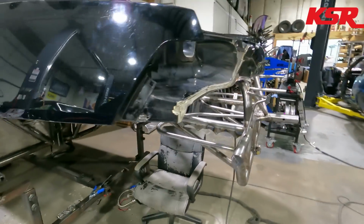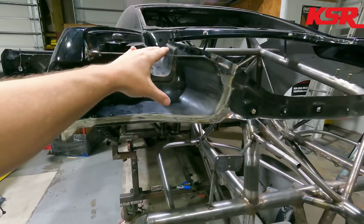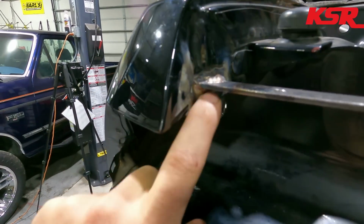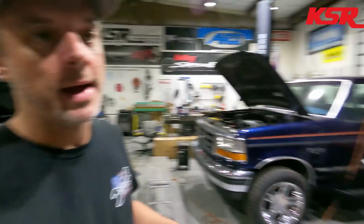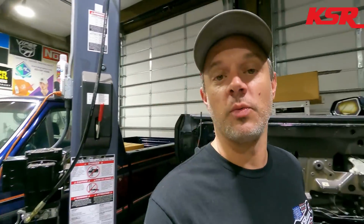All right, so lots of different stuff happening. Got all the back bumper off, welded up all the pieces here, which I used some silicon bronze for. This isn't the greatest example of it, but the silicon bronze wets in at a really low temperature, which I think I may have said before, and it makes it to where you can weld stuff to sheet metal and not warp the sheet metal real bad. I didn't do a very good job of it right here, because you can see a little warp in there, because I actually don't know how to weld. I actually got it kind of hot because that was 1/8" steel that I was welding to the sheet metal there.